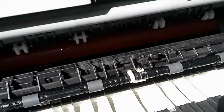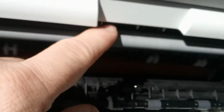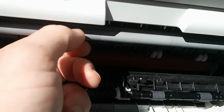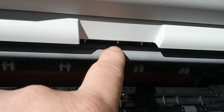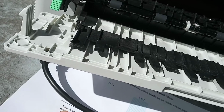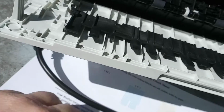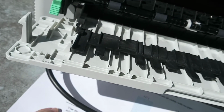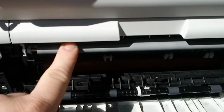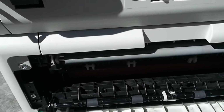Now, in really bad printers that are really coated, the turpentine you'll use to clean these rollers will only clean the dirt and the really basic oils on it. In printers where the paper you've used has a really high amount of, especially if the paper was made out of pine chips, what is it, pine tar oil, you have to clean these rollers with oven cleaner. I'll just go and grab a can and show you what I use.